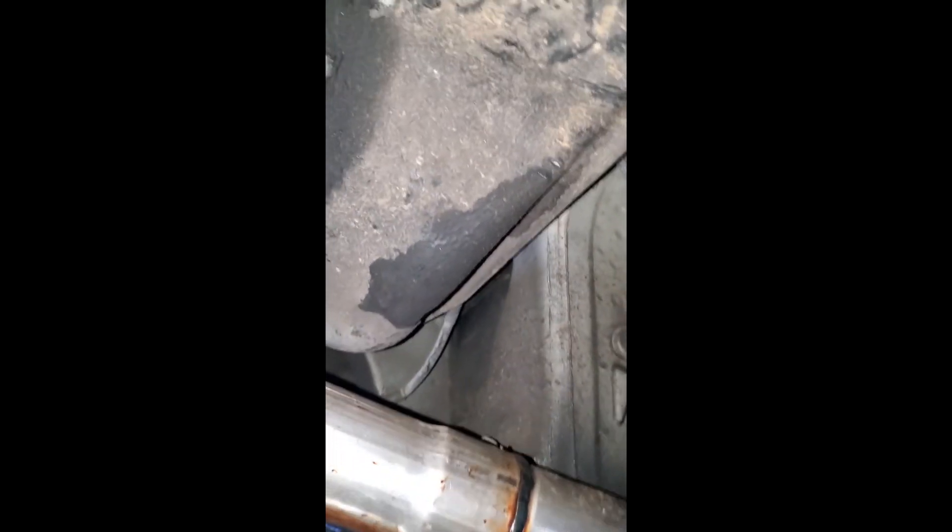So the reason why this broke: the mount on the cover that I bought possibly gave out because it was weakened by these cuts right here on the actual cover, and then that's what made the diff drop and then made the diff break. So the drive shaft was definitely not the weak point here — it was the mount that decided to just give out, which we're going to go ahead and replace for now with the same exact part until I decide what to do. Stay tuned.